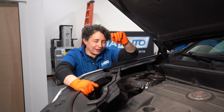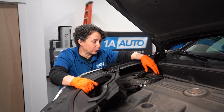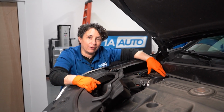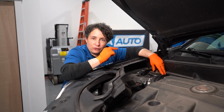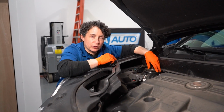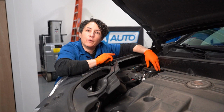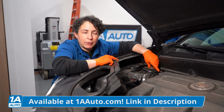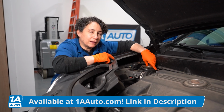I know, I didn't forget. I said I was gonna show you a quick way to diagnose strut caps also. Now, I don't think we have a problem with the strut cap right now, because I found the broken spring. The strut cap is the end result of the broken spring making that noise. Now, if we kept driving, then I would probably have a broken centerpiece in the strut cap. But I explained already why it's probably making noise.